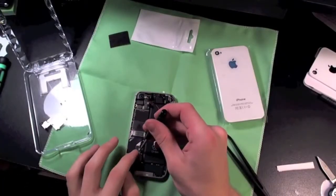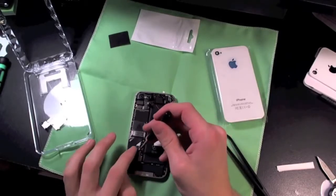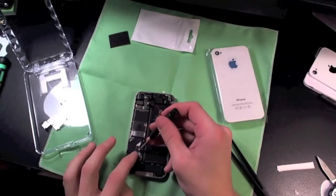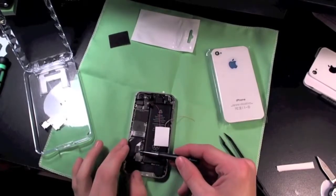It really is so helpful if it's magnetized, guys. I almost just dropped my screw down in between the battery, and that wouldn't have been good. So really do magnetize these screwdrivers before you use them — all you have to do is rub them onto a magnet.